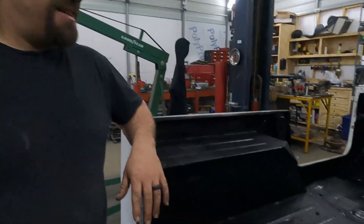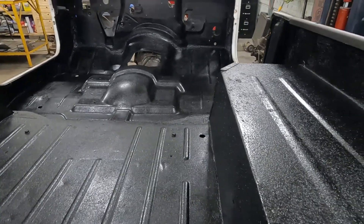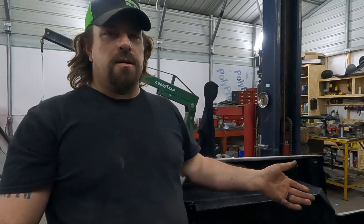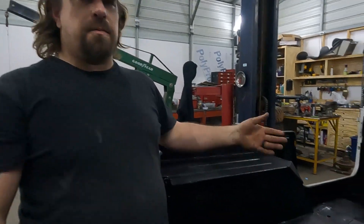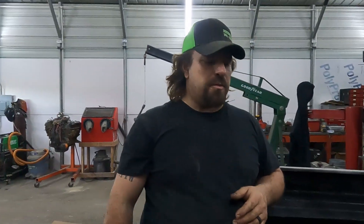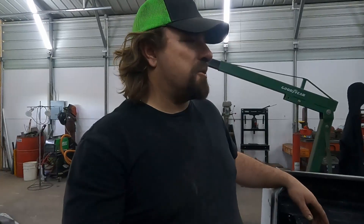Our bed liner's done. It's not completely dry yet, but it's tacked up pretty good — you can touch it and it doesn't come off. We ended up doing two coats because the first coat felt a little thin; now it feels nice and thick and I think it'll last a long time. Now if we bury this thing in a mud hole and fill the inside with water, the last thing we need to worry about is how to clean the inside of the Jeep — we'll just pressure wash it. It was really easy to do. We used about a half a gallon for two coats on something this size. We only did one coat on the brush areas since it went on real thick. Comment below what you're going to use this stuff on — I'm interested to see how many different uses we can find for this Herculiner brush-on bed liner.